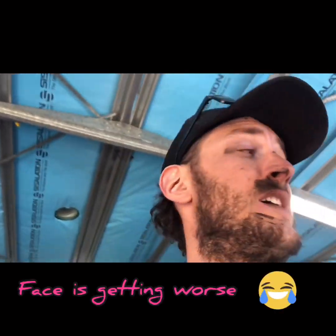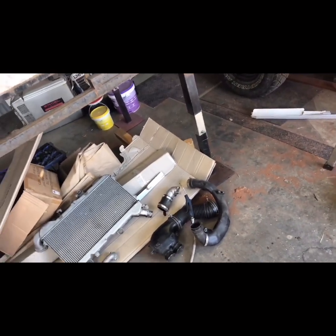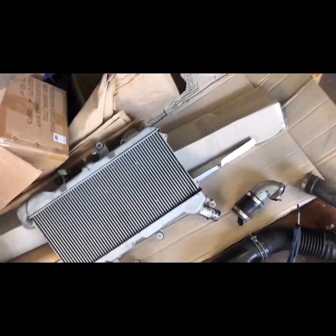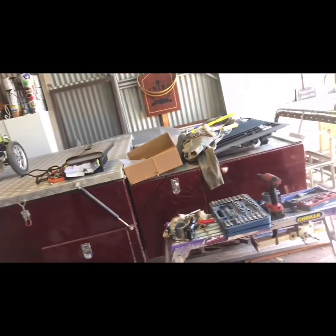It's getting ready to go back together now. We've cleaned the valley out, blown all the intake pipes and everything out. I've cleaned all the EGR crossover pipe and everything out. I'm going to clean all the intercooler out and flush it - I want to get all that dirt and stuff out of it. Got the butterflies out of there too. I'll just throw you on a time-lapse - it's pretty straightforward, just reverse of what I did pulling it apart. Put it back together, get the engine running and go from there.